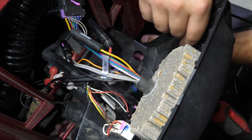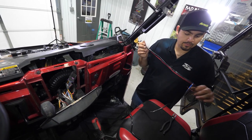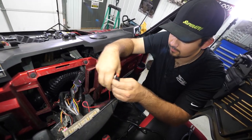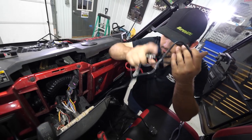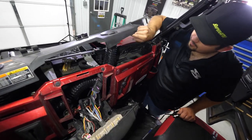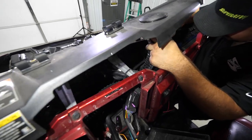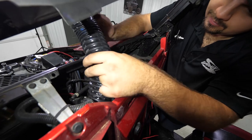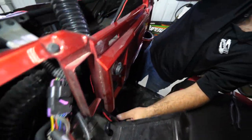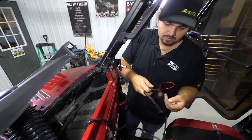We've already done this, so we're going to start running our wires. Since we've got our holes drilled for the two studs and the hard-wired switch, we also popped a hole so we can feed our wires up through here. We'll pull a lot of the slack through, and once we've got the majority through, we're going to locate the grommet. We have a cab heater installed, so we can't completely remove the top portion of the dash without disconnecting it, so we're going to leave it and feed our wire through where all these wires run down in here.